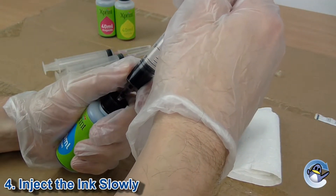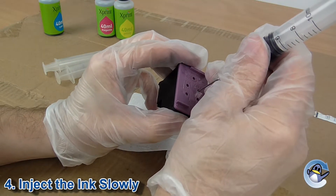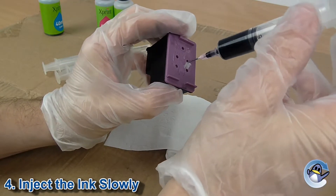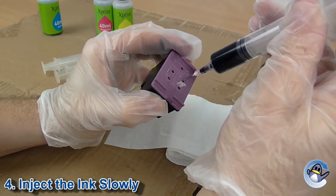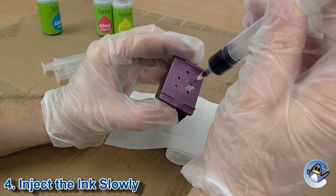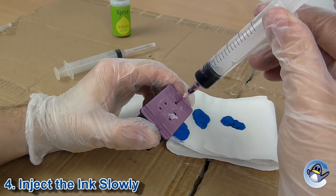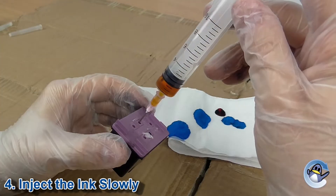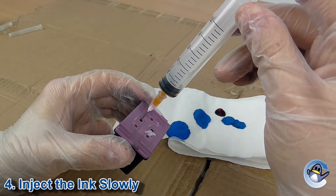Use a syringe to suck up the appropriate amount of ink for the cartridge in question. Now insert the needle into the sponge so that it is most of the way into it without risking jabbing the membrane or printhead in the bottom. Now slowly inject your ink into the sponge, ensuring the ink doesn't start filling the void above the sponge in the cartridge. We don't want to have ink slopping around in the chamber or flowing into a neighbouring colour. I would recommend checking out one of the more specific guides for recommended quantities, but you can always just fill it until you see the ink is no longer being absorbed by the sponge and then suck a small amount of ink back up again.